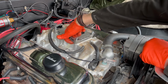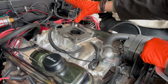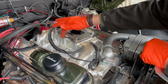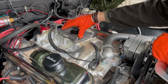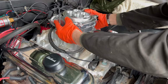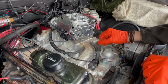Obviously there's a gasket I've put underneath, which comes with the kit. Don't tighten them up too tight. Do them diagonally first, so you get an even load when you're tightening them up. You obviously want to make sure there's a definite seal, because you don't want excess air getting into the carb, which will affect all the readings and make it not run as well. So after that, that's onto there, and the fitting of the carb. It's that simple. I just need to bolt these on. I'll come back to you when that's done.